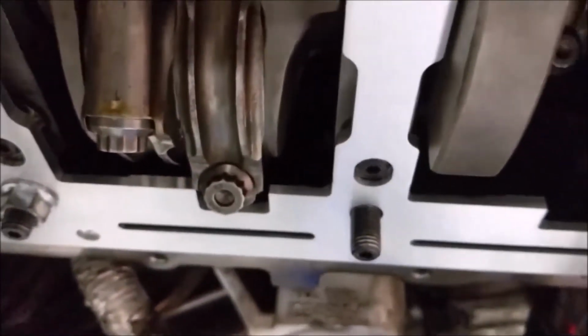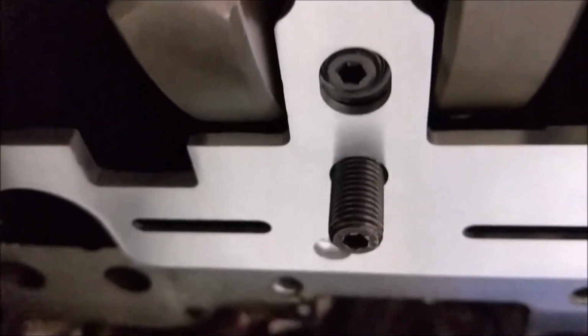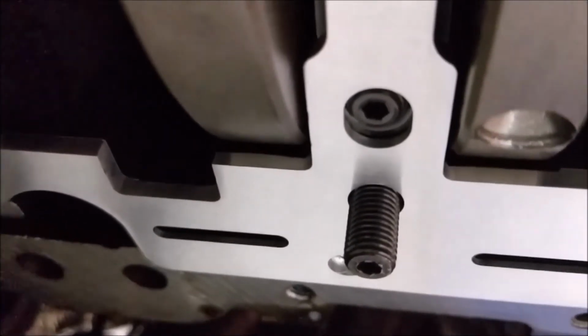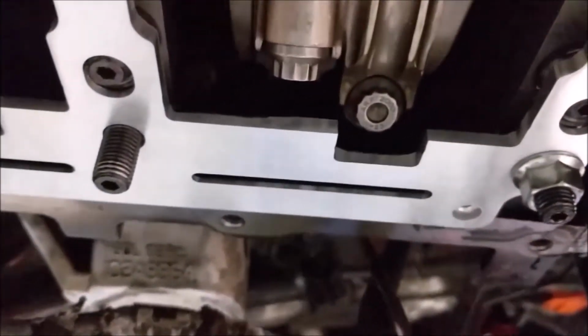And now as this thing rotates at a high RPM, it swings out and actually gains or grows a certain amount. Not a lot, but enough. So you got to make sure you accommodate for that growth.